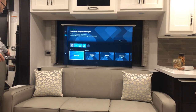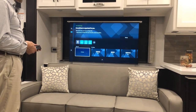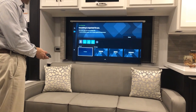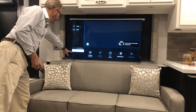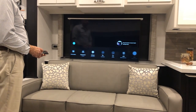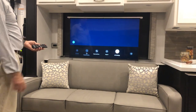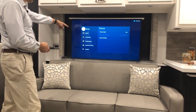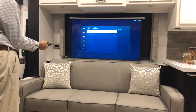With the TV remote you can turn it on. With the Winegard over-the-air antenna turned on, you'll need to scan for channels. Go to the home screen, use the up or down arrows to navigate to settings — press the settings icon, then scroll to all settings and select it. This gives you access to broadcasting options.